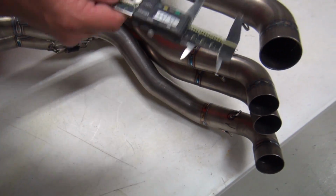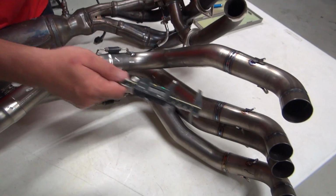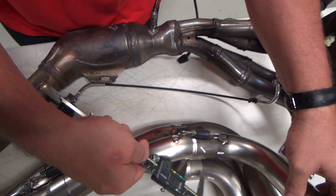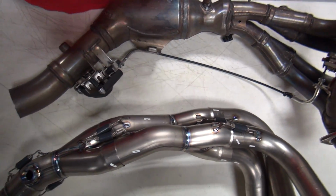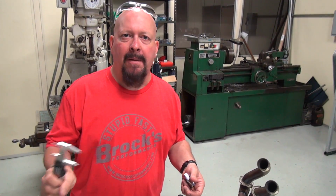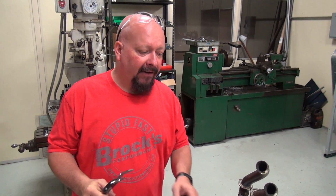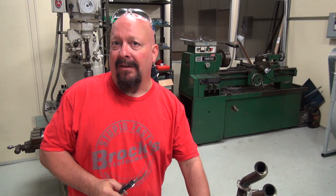We come down here and look at this. Cylinders number 1 and 4 are tied together on our Predator, and 2 and 3 are tied together in the same collector. That's to produce more torque. I mean, that's what it's there for. That's what it's designed for. When you're coming out of a corner, you need as much as you can get. Like I said, partial throttle operation. This configuration has shown to work very, very well without hurting peak power.